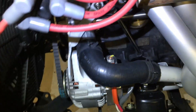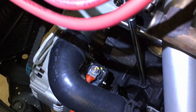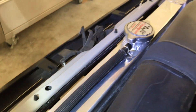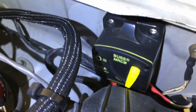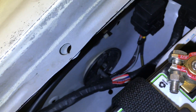The alternator is a 140 amp unit also from LC Engineering — they sell it on their website. I redid some of the lugs and ran a dedicated wire, I think it's eight gauge, that red one, all the way along the harness. And if you look in over here, I've got a 135 amp fuse breaker wired into the mix.